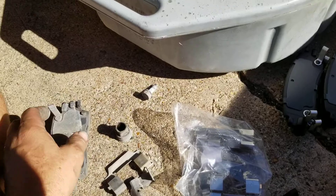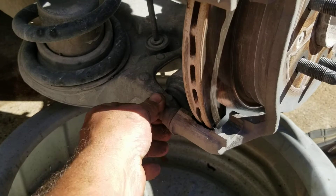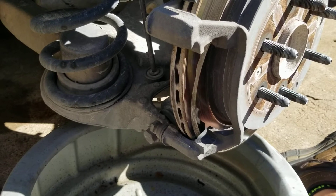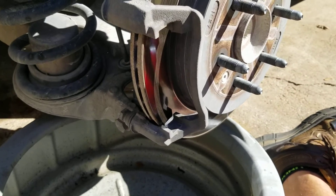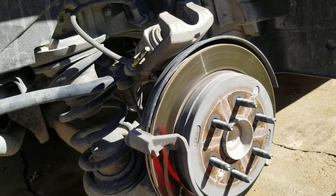This is really not that hard of a job. Always check your pins — if they aren't nice and clean, take them out and clean them. It's not that hard. If they're stuck, get them loose and clean them, or get another bracket, because that's the reason why brake pads get all crooked and messed up. Anyway, that's going to be it — y'all have a good day.